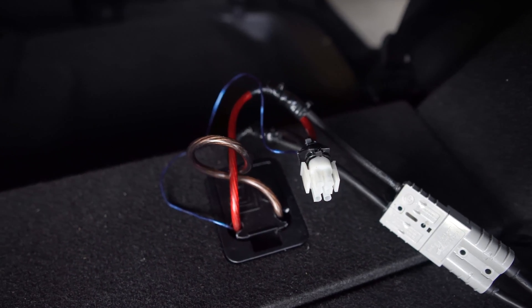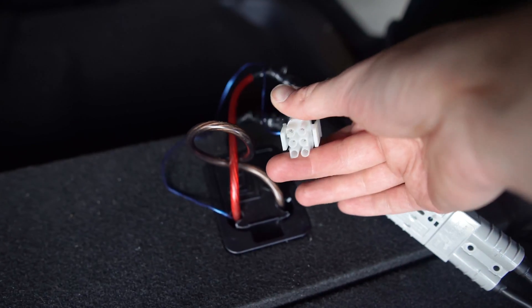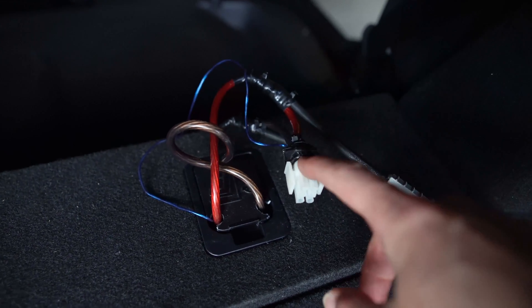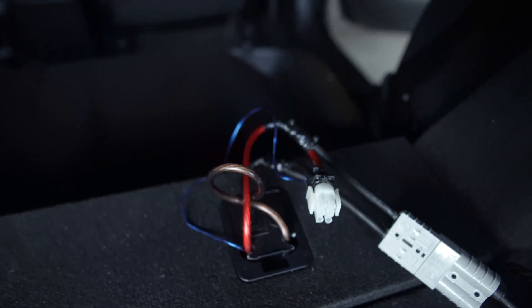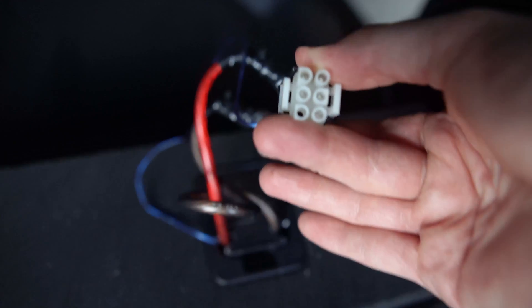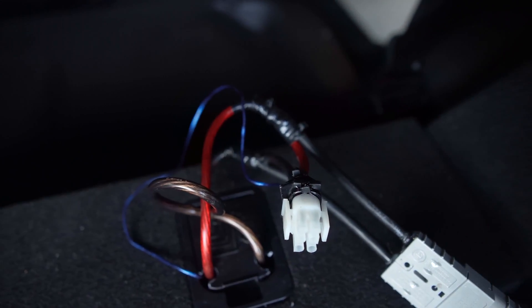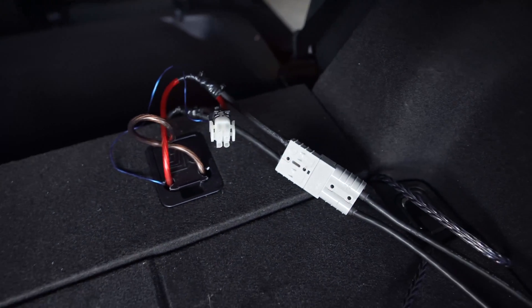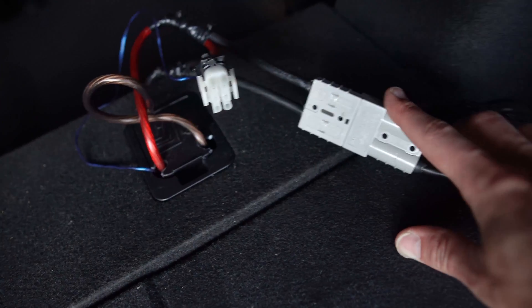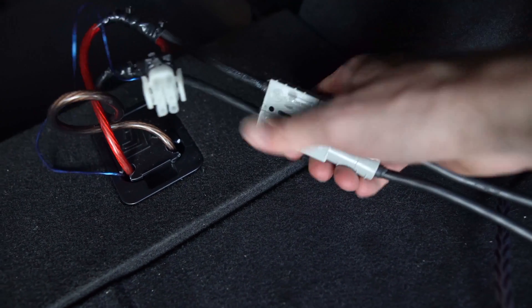On my sub and previously on my inverter, I was using what are called Molex plugs, which are nice — they only plug in one way and they're pretty cheap. But the problem is when I plugged the inverter into a four prong Molex, there wasn't enough amperage available through that plug because these things are tiny little pins and they just can't handle 500 watts. So it was getting hot when I was running both chargers off there and the inverter was beeping at me. So I've since gone and replaced it. That's why I'm using this six gauge cable going into what is instead called an Anderson plug, which can handle a lot of wattage — 50 amps — it's huge, really secure, and not going to get hot.